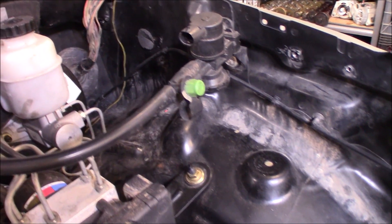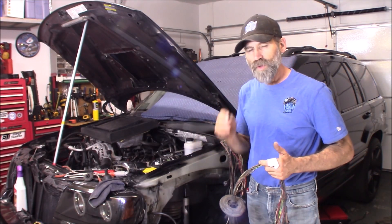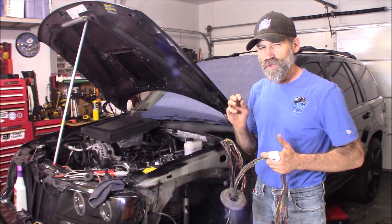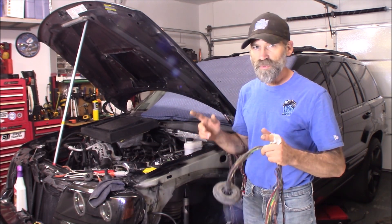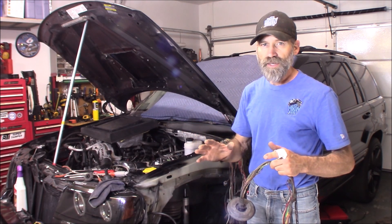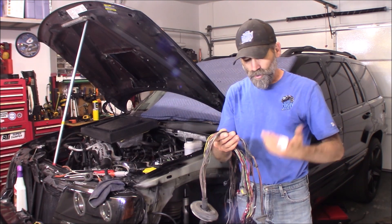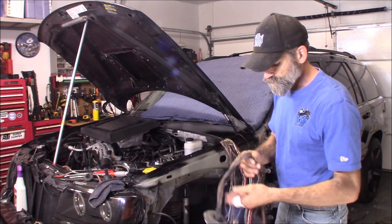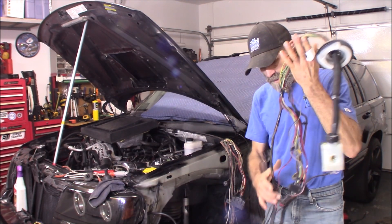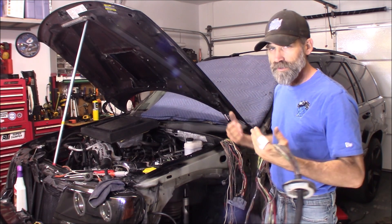Most of the wires are all removed — I got them to that point right there. One thing about doing a wire tuck: in most situations you're going to end up taking a longer route than the harness originally took. You could add a section of wire, but that means two splices. To limit that, I got another harness out of the same year vehicle so the wire colors will all be the same — as long as there wasn't a revision change during the year. I can cut it at the appropriate point, cut this one at the appropriate point, and make one splice there.